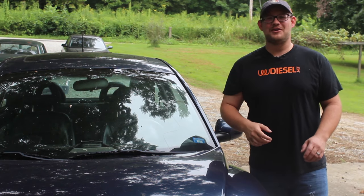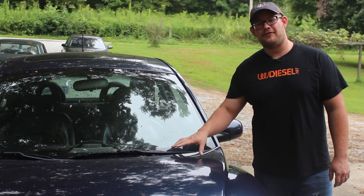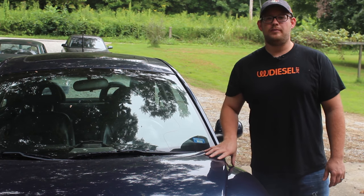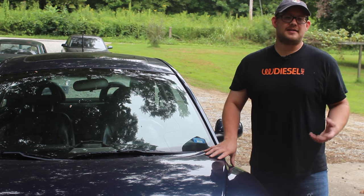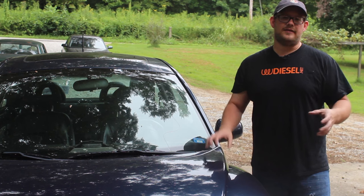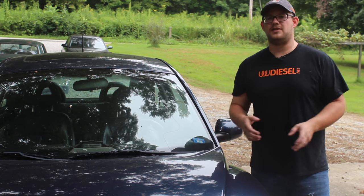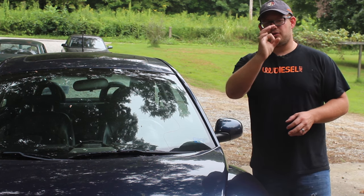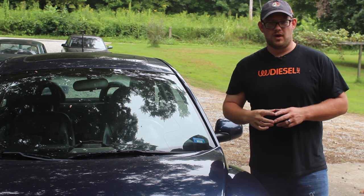Hi, this is Ryan Turner with VWDiesel.net, and today we are going to be cleaning the intake manifold out on a MK4 TDi. This happens to be a Beetle, but it happens in a Golf or a Jetta all the same. The EGR gas comes back through the intake manifold, sticks to the sides of it, and begins over time to build up a thick plaque buildup, which we refer to as diesel boogers. These have a tendency to choke down the intake manifold to about the size of a dime, and it can even cause a car not to start or run very well.